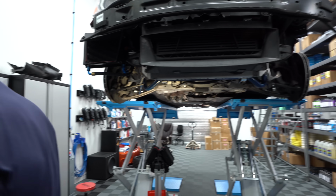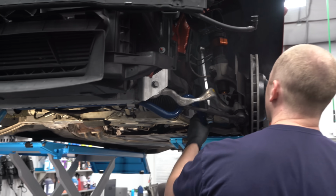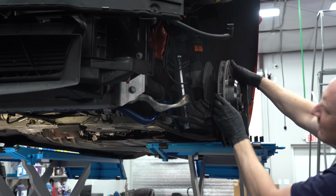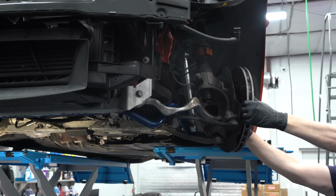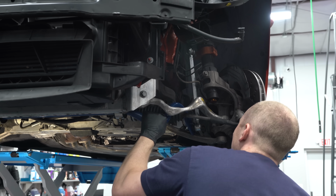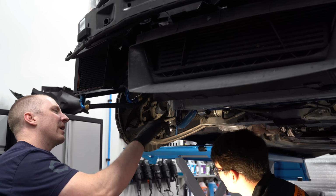And let me actually torque these now by hand. Feeling good, I'm actually getting something done. Let's see where we're at on our sway bar. So this is just kind of a loose fit. So, what's holding me up here? Well, the sway bar's hitting the lower control arms, and that's not good. I guess I'm going to have to take this control arm off again. This is upside down.